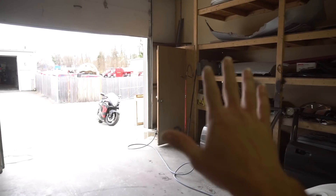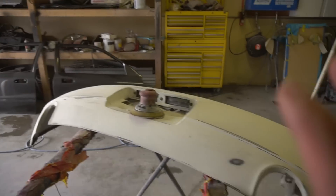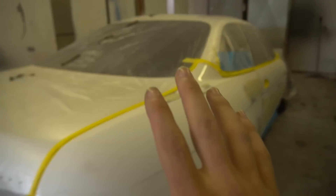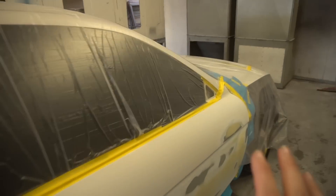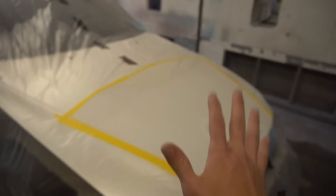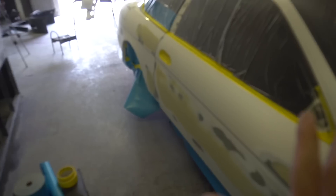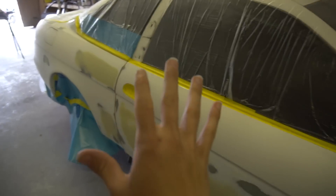The compressor started to overheat again so they let it cool down. Still got to do the bumpers, skirts, and lip, but the car itself is all masked off and taped off. He only needs to prime the spots where he did bodywork so that everything is one color — that way he can see if anything stands out, anything's too low or too high. He ran out quick to get some paint for another project. When he's back, we'll start priming and see where we lie with all the bodywork done.